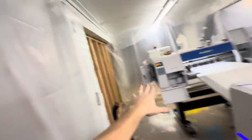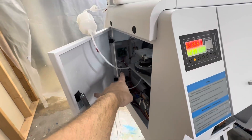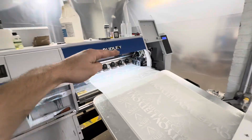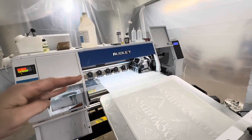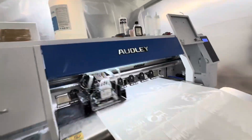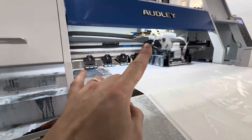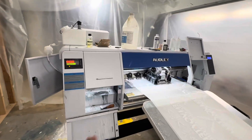Just that little bit of having the ink travel uphill made the resistance on the white ink lines so much more difficult for the printer to get ink — especially the white ink. It made it so much harder for the printer to get white ink because it was basically having to work really hard to get the ink into the system. In my mind, that's a design flaw. Those holes should be higher so that they are either equal with or slightly higher than the elevation of the white ink reservoir, which you can see right there.